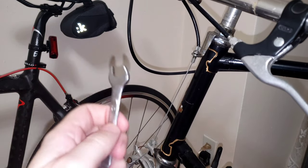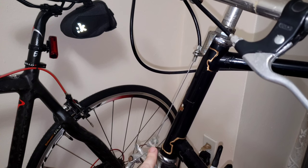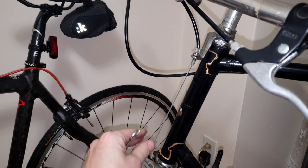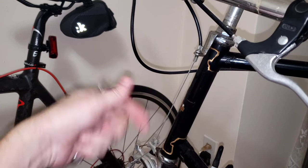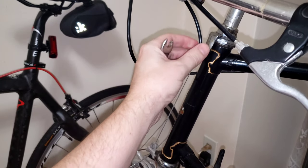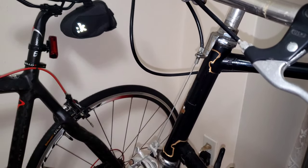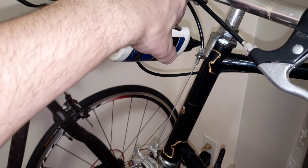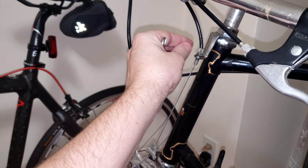Now let's move to the cable tension. You're going to need wrench number 8 on one side and wrench number 9 on the other side to loosen the bolt, which will allow you to pull the cable and apply more tension. In this particular case the tension is just fine, but there's an easier option: messing with the barrel adjuster right here. Turning this bolt will tighten or loosen the cable tension much more easily. Since this bolt likes to seize and get a little stubborn, I like to apply some Park Tool lube here to give it lubrication, so next time it will be much easier to work with.